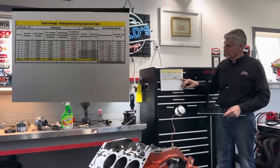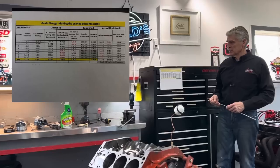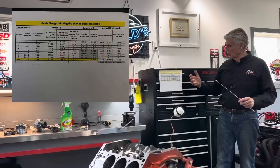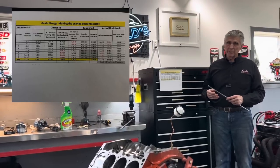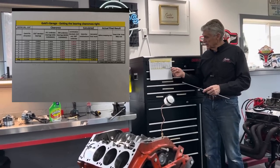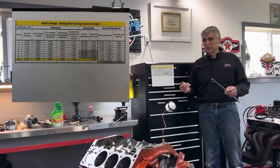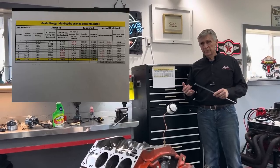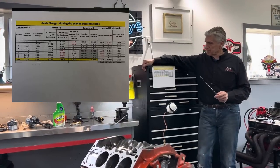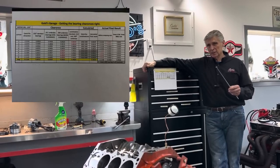I've swapped the rods already and we're making progress — Blakely stopped by and we've got two pistons in the engine. In the end, we got the result we wanted — no harm done. By the way, because of this situation, all the bearings are 0.009 now with no mix and match, because I actually needed all the clearance I could get on number one and two cylinders. So I used 0.009 on both ends — every single bearing is 0.009, no mixing.